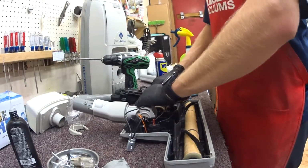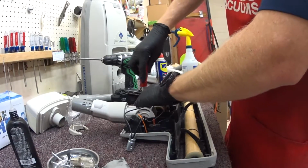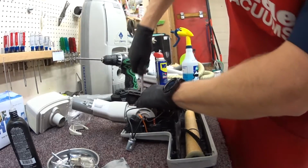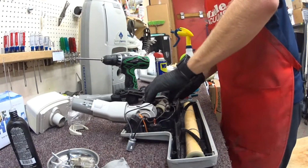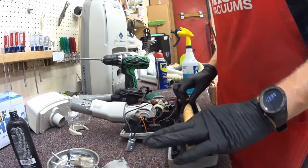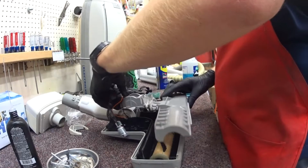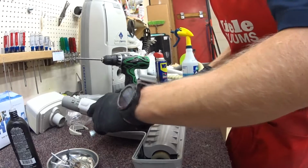Alright, set the tension on the motor. Those should be pretty snug. Don't want that motor going anywhere. Got tension. Excellent. You don't want to make this too tight. If you haven't ever set a chain or a timing belt or something like that, they don't need to be super tight. The gears just need to grab them. In fact, a little bit on the looser side usually means it's going to work a little bit more efficiently.